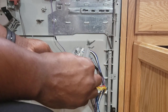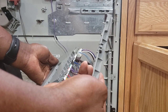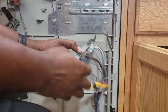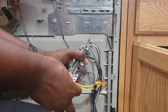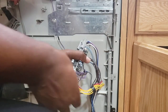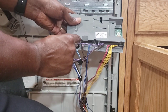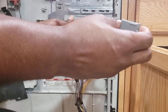To put this back, you see you have groove positions — one and two over here. You place it back this way, make sure your cables are out of the way, and then you just click it back inside. As I was saying, there's a clip here that you push to get it in to remove — same thing on the other side. After that you take the cover for the power cable.